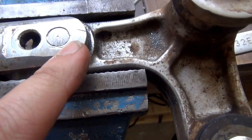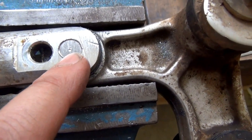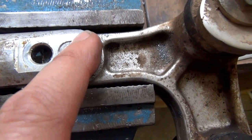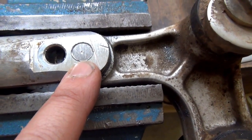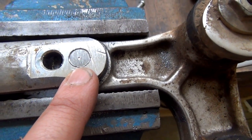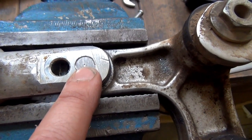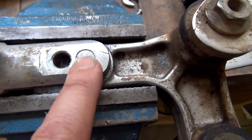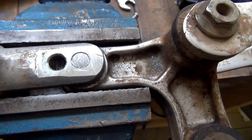I was just getting ready to drill a hole, and I've put a center punch. I've just noticed when I've put the center punch all around here, it's moved. So I reckon it was like self-welded itself to it. But yeah, I've done a center punch. I'm just going to file that just to smooth it, and then I'll get a drill, drill it in, and then use my little reverse tapper thing.